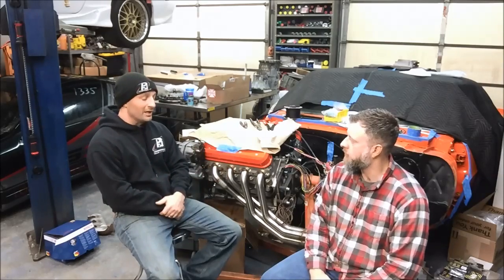We actually use one of those boxes in our shop car. It's got an L92 Gen 4 motor — essentially the truck LS3 — but we're running speed density on a Gen 3 PCM using a Lingenfelter box and one of PSI's harnesses. There are always reasons people want to run drive-by-wire or drive-by-cable, but that's a solution for you.